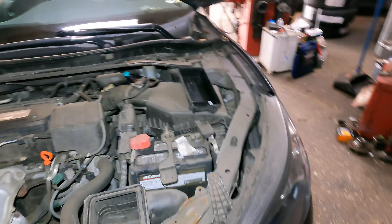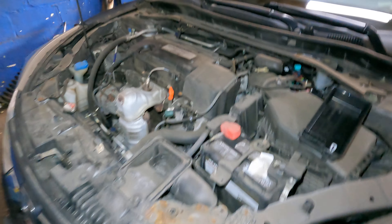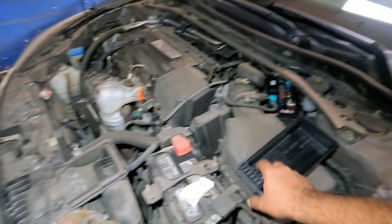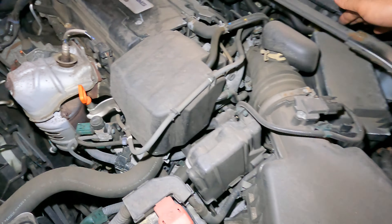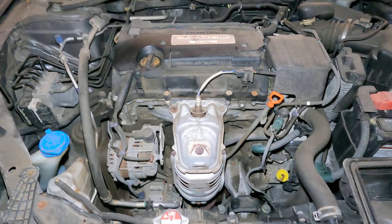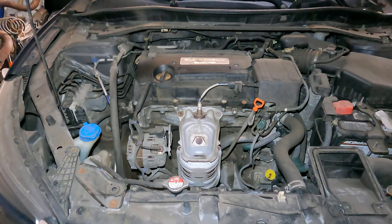If your car overheats, check these basic things and don't kill your engine — because you can blow the head gasket and destroy the engine. Take your time and fix it properly. If you check power and ground with a test light and the fans have power, the fans are bad — replace them. Change your thermostat every 60 to 70,000 miles, and while you do that change out the switch, which also gives you a flush.